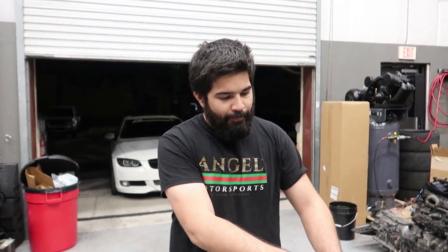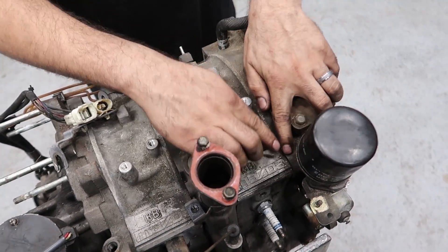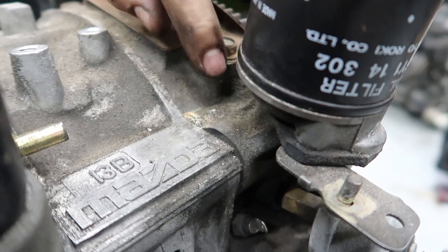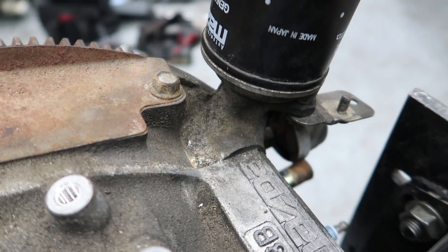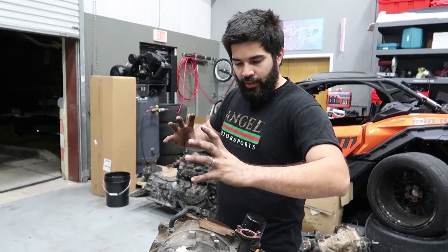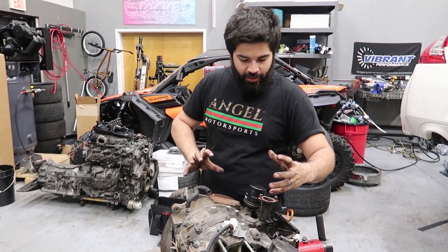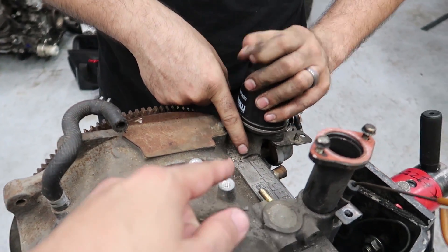Angel was telling me something really cool about my engine — I have a good S5. The S5s come in different models in terms of the rear plate. This dowel area is the big dowel area, and this is the weakest point of the rotary engine. This one already has the big dowel area and it has reinforcement right there. That reinforcement keeps it from cracking.